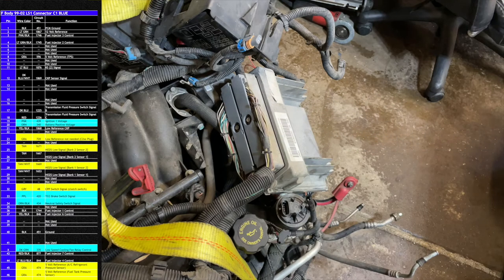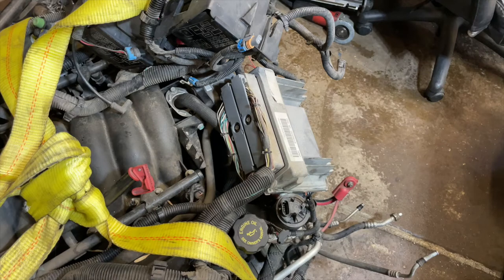Once you've pulled the pins out and removed all the wires you don't need, you can open up this harness — I would leave it on the motor so you never lose the shape of the harness — but you can pull all this stuff off and rewrap it back up later. Pull all the wires out though, rip them all the way out of the harness. Then when you have the stand-alone harness, it'll tell you this is a ground, this is a ground — you tie all those grounds together to one ground wire. It'll tell you this is a constant power wire — you tie all those together and connect them right to your battery. Then the other wires, I think they're pink, those are the accessory — meaning that's what's turning on the system — so all those wires get twisted together and go to your key. So when your key is on, everything's powered up, you're ready to fire. All you gotta do is hit a start button, the starter will kick over, it's gonna run. It's so simple, it's literally Legos, but a motor.